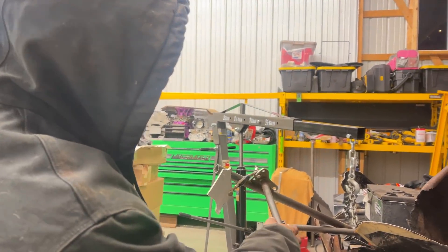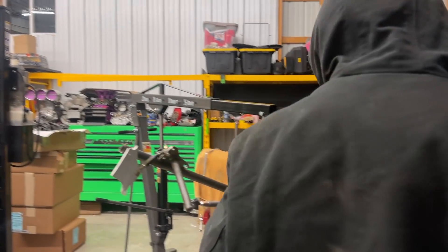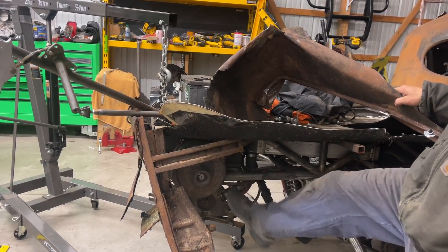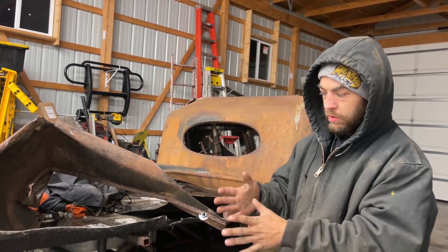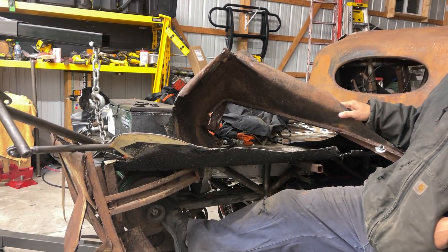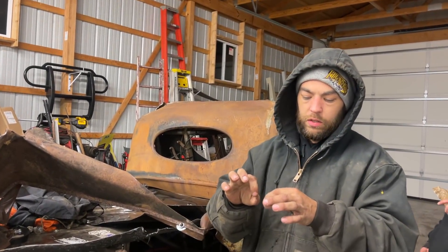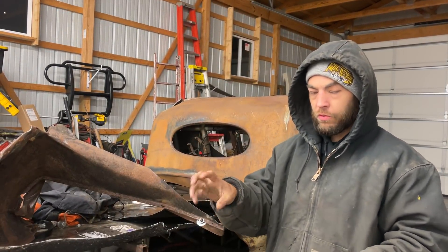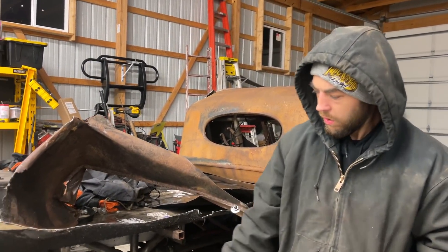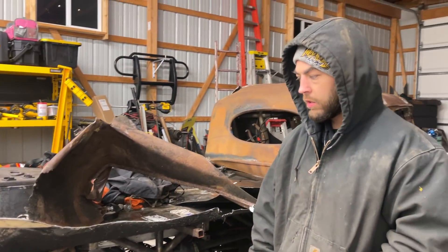You can see the ballast weight we have in the back of the car for the no-prep stuff — none of that stuff moved. The way I did the weights, they press up against the frame, secured with normal nuts plus a security feature. I put a taper on them, threaded them in, then locked them down once the outer piece was butted up tightly against the front one.